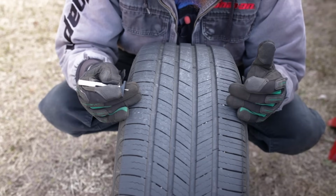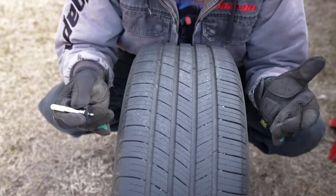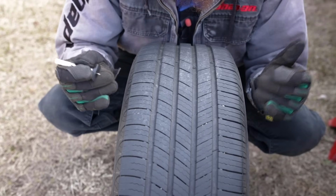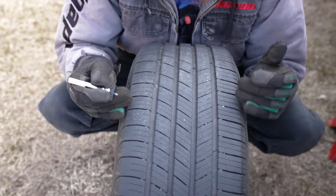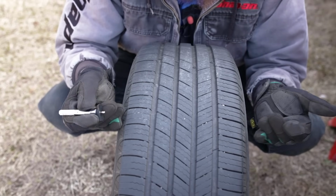If someone has told you that, oh, you got a nail in your Subaru tire, you need all 4 tires, they're not trying to scam you out of a set of tires. They're telling you truthful information. One downside to owning a Subaru is the tires, and if you have a situation with just one tire. But luckily, places like Tire Rack now offer the service to shave down new tires to match, so it's not as big of an issue as it was in the past.